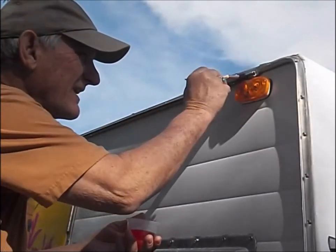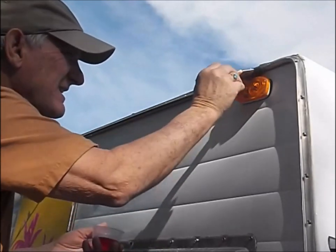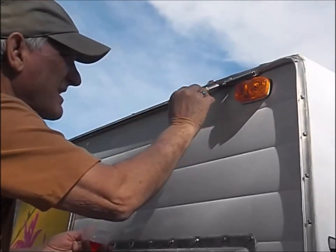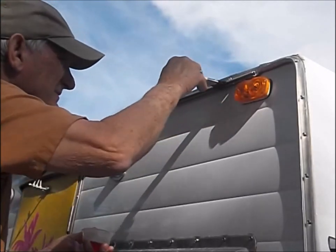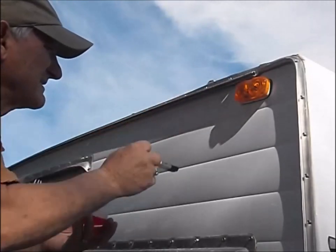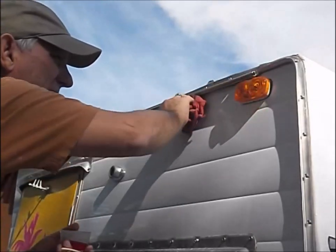You just get in that track and scrub it. It's the crusty oxidation that we're after — that causes friction. We're not trying to polish it necessarily, we just want it smooth, and this stuff dissolves that crusty stuff. It's probably not a good idea to get it on your paint, which doesn't seem to be a problem, but keep a rag handy.